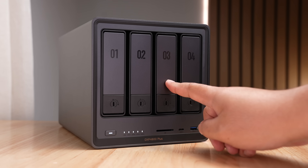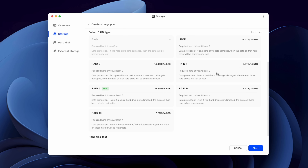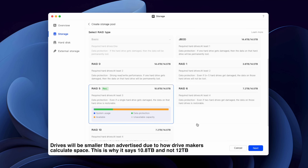It's important to note how many drives you can have in the DXP4800 Plus, because as a minimum, it's best practice to use one of the drive bays to house a parity drive, meaning you don't get to use the space of that drive. But if any single drive fails, your NAS will give you a warning but keep on chugging. So the more drive bays on a NAS, the better. When setting this thing up, the NAS will lay out your options and tell you the impact of whatever decision you choose. For most people, four drive bays is a great spot — you can start small with a little room to grow. Ugreen sent this over with four 4TB hard drives, which means if I use RAID 5, I'll only have 12 total terabytes of storage.